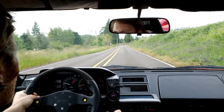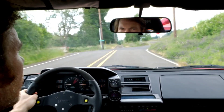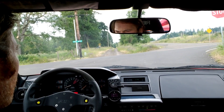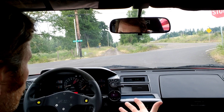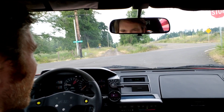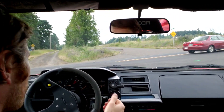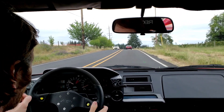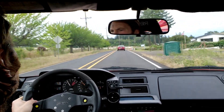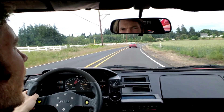Versus something like race with a high slip angle. I don't know if you could tell, but it kind of moved a little bit — it allowed me to drive it and it was still engaging traction control. The final thing is it has launch control, so when the car is in a neutral state, all you've got to do is rev it up to 4,000 RPM and it'll engage launch control. Overall, this car is a ton of fun, makes really good power. So that's with traction control engaged — it's completely drivable, and that's with a higher slip angle.